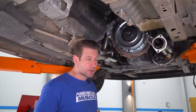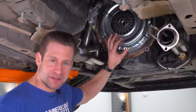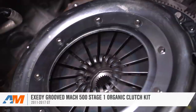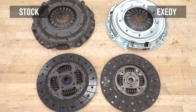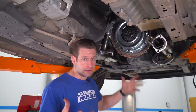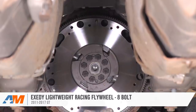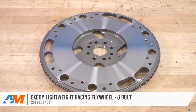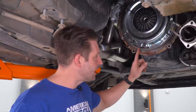We also used the transmission being out to tackle some performance and maintenance stuff for Leslie's ride — namely this shiny brand new Exedy Mach 500 Stage 1 clutch, along with their matching flywheel. A nice step up from the stock clutch with an organic clutch disc. It's going to be very streetable, very easy to drive — feel like she's driving a stock clutch with added holding capabilities. Behind that is Exedy's brand new Chromoly steel flywheel, almost 10 pounds lighter than the factory cast iron option, letting you pull through the gears a little bit quicker and feel more responsive overall.